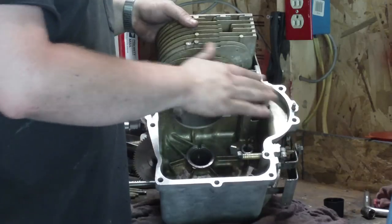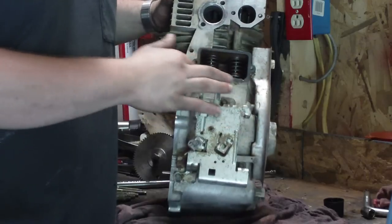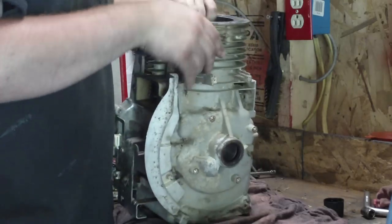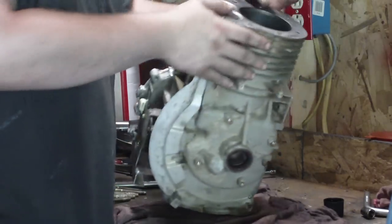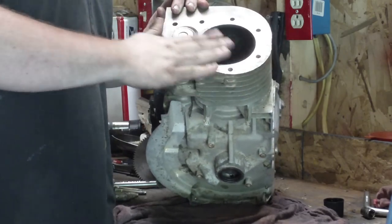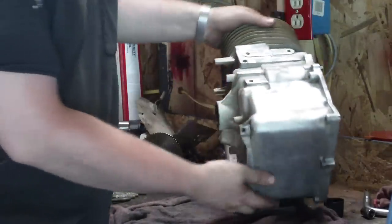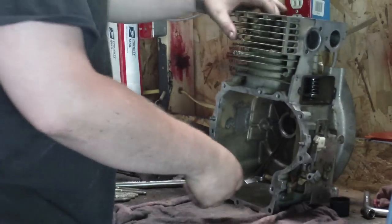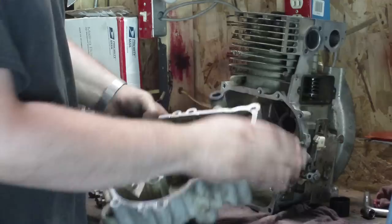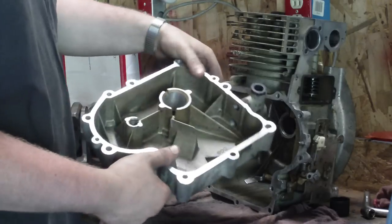Here's a closer view of all the sludge. I just got through and cleaned up the block. I took a wire brush from the drill all the way around here and got all the old gasket off. I decided to leave the valve cover gasket on here because it's actually good — no reason not to reuse it. If it leaks, I'll put another one on. I cleaned off the top of the head good enough. I wish I had a milling machine so I could surface all this, but it'll be all right. I wire brushed all this just to make it look a little bit better, and also the crankcase cover — I got it all cleaned up. I probably could put a new oil seal in this.